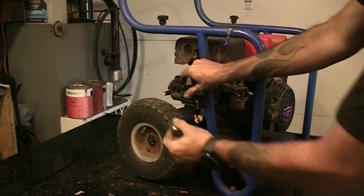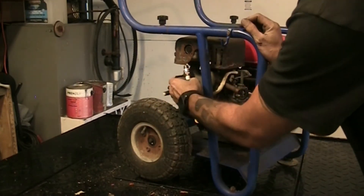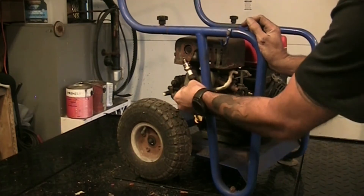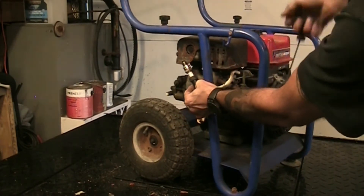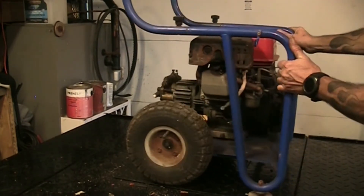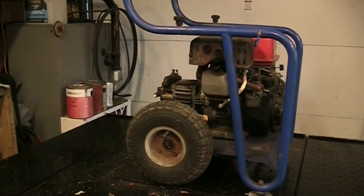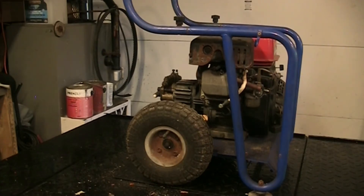Pull the plug wire off - I'm just going to stick the plug in it externally. We're likely going to end up changing this one anyways, I just wanted to do a quick spark check here. Oh yeah, good spark, solid. Still gonna pull that plug out and have a look at it too. It's got spark - figures it's a fuel problem.